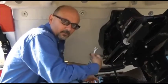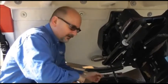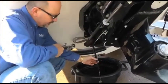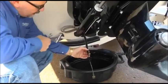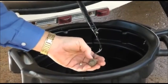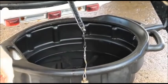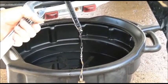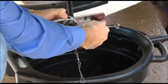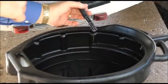Now that we're done running the engine and warming it up so we can drain the oil, that's what we're going to do. One advantage to having a newer style boat with this engine package is the manufacturers put an oil drain tube on the bottom of the oil pan, making it much more convenient to drain the oil. The boat manufacturers tethered it to the hull plug, so when you take the hull plug out you can pull the hose out — much more convenient than sucking it out through the dipstick tube. All we do is just loosen up the plug with two wrenches, then open it up by hand and let it drain.